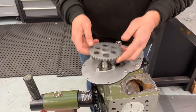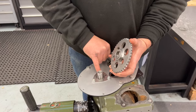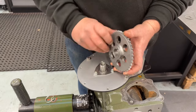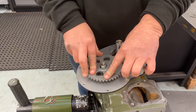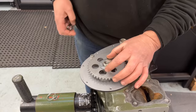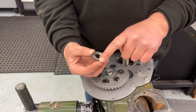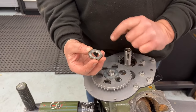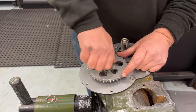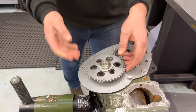The next thing is to check and set our camshaft end float. That is controlled by the distance between the camshaft plate and the step on the timing gear. We drop the gear into place, make sure it's pushed fully home, then drop in our lock tab and the camshaft retaining nut. It has a registration boss — a flat machined surface that goes to the lock tab. Wind that on and torque it to its full tightening torque before checking the end float.